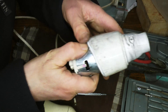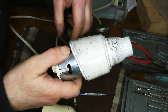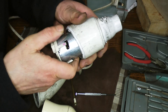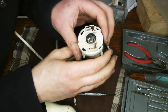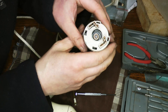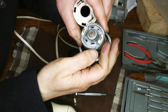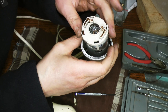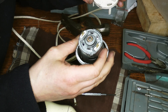You might be able to pull it as well, but it's quite a tight fit. I'm going to have to take this off again because I'm actually putting it back together at the moment, having checked my fix worked. But I've got to put in this rubber seal which I left out. When you are removing this plastic bit, make some kind of mark to make sure you get it the right way around. This one has a '1' embossed in the plastic, so I've made a pencil mark to make sure the '1' is close to that pencil mark, ensuring the motor turns around the right way.